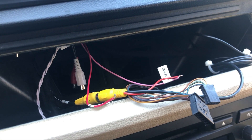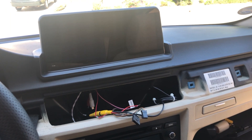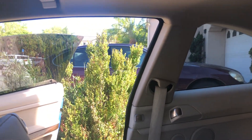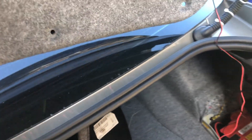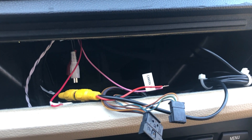Since converting, that didn't work, so I talked to the guys at Avon about any difference between the wiring for the Android head unit with a manual transmission, and they said there was. Further back in the wiring harness for the rear view camera, there's actually a second positive and negative which are optional. The idea is these go to the positive and negative of your actual reverse bulb, and that supplies the power. When power is received by the reverse light, it triggers the positive connection attached to the pink trigger wire, telling the car it's time to reverse, and the camera activates.